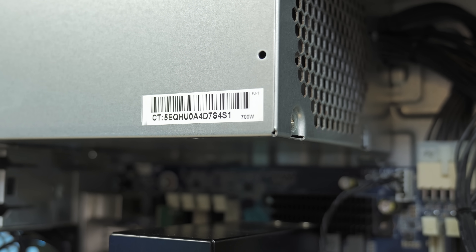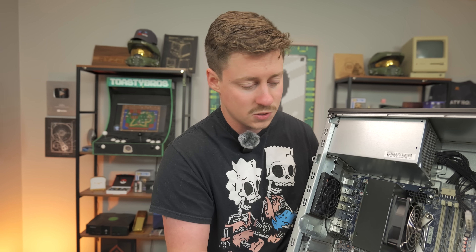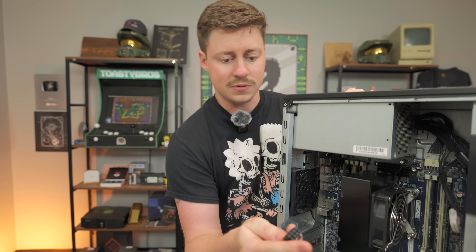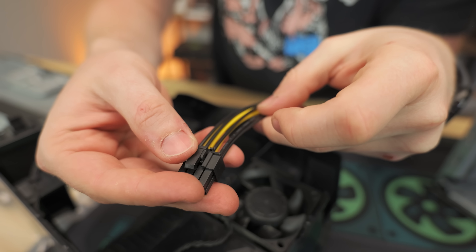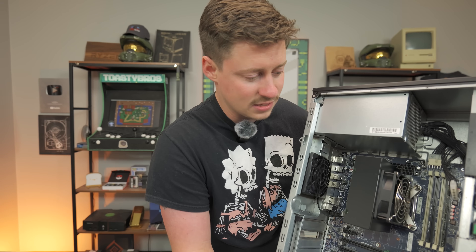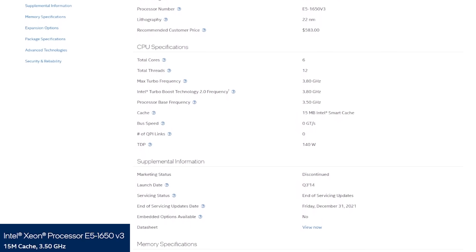They do only give you two six-pins, which is a bit odd — I guess when you had GTX 900 series, a lot of those used six-pins. So we are going to use a six-to-eight-pin adapter. When adapting these six-to-eight-pins, you basically have positive power, and the black ones are all grounds — two extra grounds daisy-chained on there. In theory it should be nice and safe, definitely a lot safer than SATA or Molex two-to-eight-pin adapters. The CPU is the E5-1650 V3, a six-core 12-thread processor, so it's a pretty upgradable build with multiple PCIe slots.